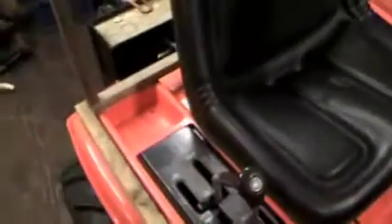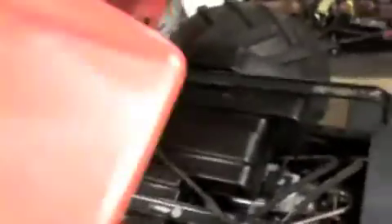I'll take the cab off and show you what I did underneath the fender pan with the rear lights. For underneath the fender pan, I got my lights wired up so the main live wire comes down and chases the gas line underneath and comes up in the back. Everything junctions over here with a connector, the live coming over from this side. From the other side I just ran the wire along the back side of the gas tank and behind the gas tank brackets from that lamp. The ground wire from here I just grounded right to the bolt for the straps, which worked out pretty good. I got some wire loom on there just to dress it off and hide the stuff underneath. At least I got lights this winter, which will be nice — gets dark out and I can't see much of anything.